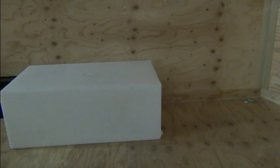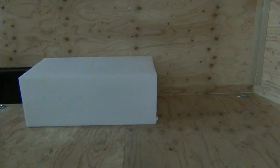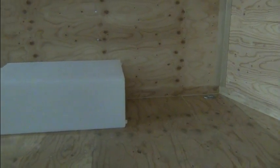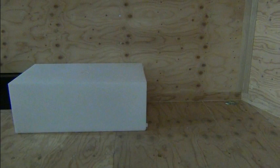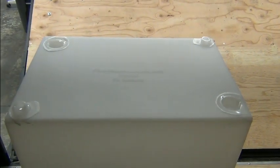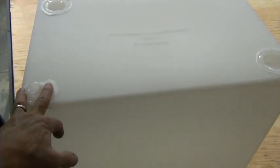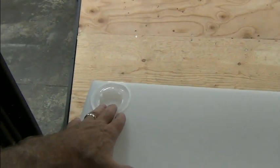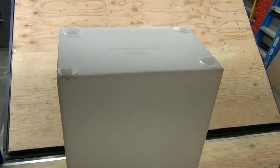If it's in the horizontal position, I think I have room under the counter to put the hot water heater. You know, I had everything penciled out. I just kind of like to visualize things also. So I took photos to refer to and just kind of letting you know the thought process and all this. So the tank has four pre-attached fittings. So I'm going to use one of the large ones for the fill, and one large one we won't use. And we'll use one of the smaller ones for the supply, and the other small one will be for the vent.